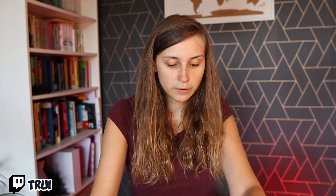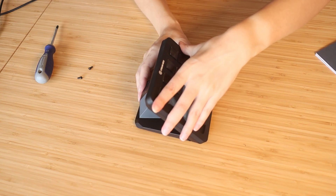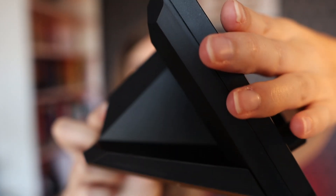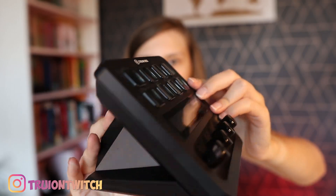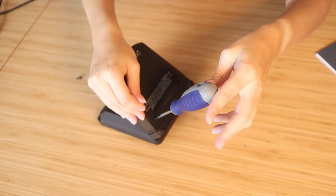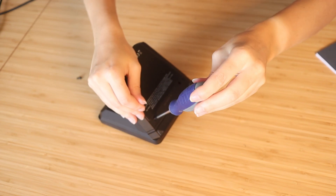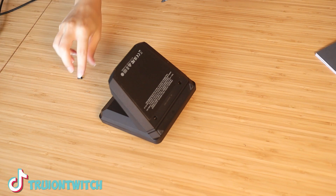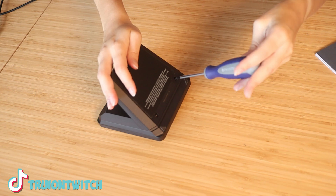Then we have this part — we're gonna line that up with the USB-C and plop that in. So you just line that up with the USB-C, plop that in, so the USB-C is connected to that front panel from your Stream Deck Plus. Then you turn it around and screw those screws back in. It feels scary but you're just screwing out a part that's basically useless — it's just something holding the Stream Deck up.